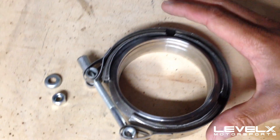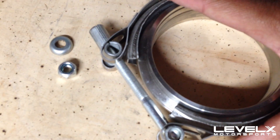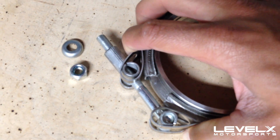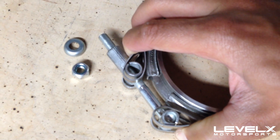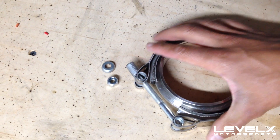The great thing is these are removable — the flanges are welded on, but they're not welded together. They're held in place by the V-band clamp, which you screw together and tighten with a nut, and that's what makes it removable again.